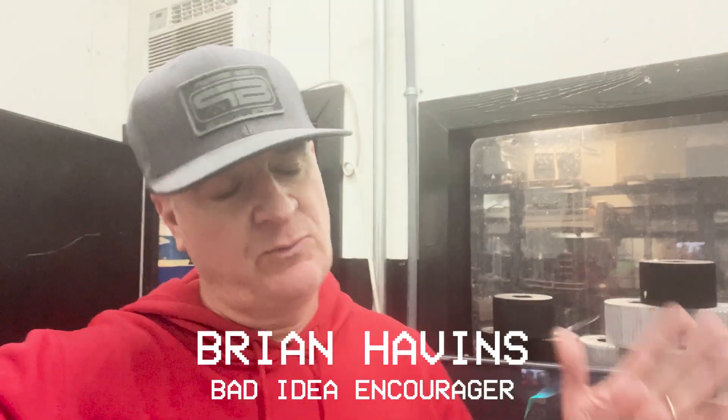Unfortunately Greg had to leave us and went back to Arizona. But Tommy and I had the wild idea: we're so close to 700 horse, let's play with it. So we're back on the dyno. One thing we noticed is we had a big boost leak — the coupler had actually blown back and we weren't making all the boost we could. So we fixed that and we're going to make some more pulls and we'll see how it goes from there. Hopefully this thing stays together.